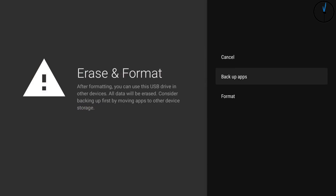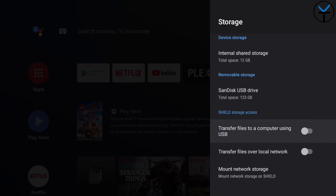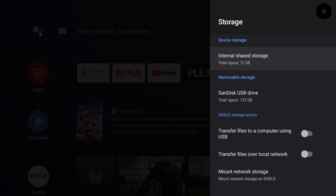I'll go ahead and format it. If there's any data it'll ask to back up, but there's nothing on here for this demo. I'll say format, it'll go through and set itself up, and come back with access to that drive as a regular USB drive. You'll notice it now comes back recognized as removable storage. If you click it, you have the option to eject or format as device storage — that makes it into adoptable storage, allowing you to offload apps, media, and content off those 12 gigabytes of internal storage. Now we have over 130 gigabytes available on the Shield Pro.